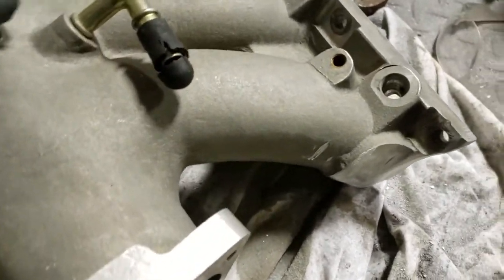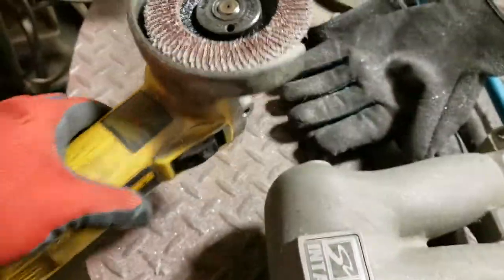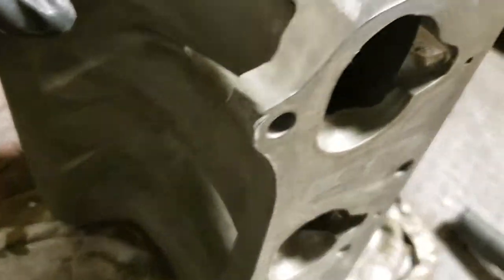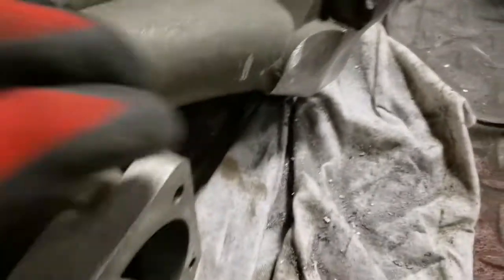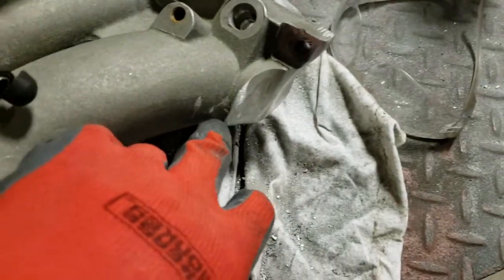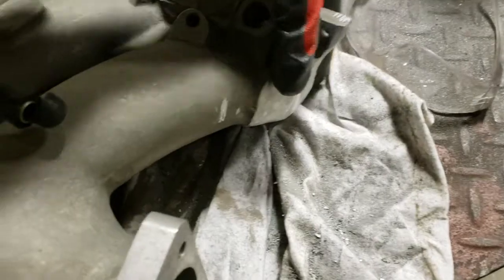Another update - we got it rough with the grinder wheel, so I'll switch to the 36-grit flap disc just to smooth everything out. We've got our flange pretty well smoothed out. I'll come back and finish out the edge a little bit so we don't have any sealing problems. Yeah, looking pretty good. Originally I thought maybe I was going to smooth out the runner too but I really don't know how much material I've got there.